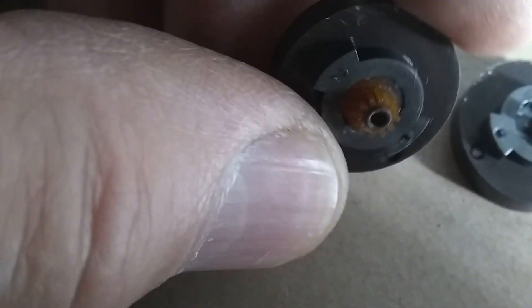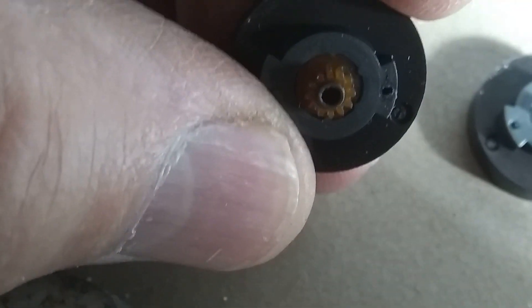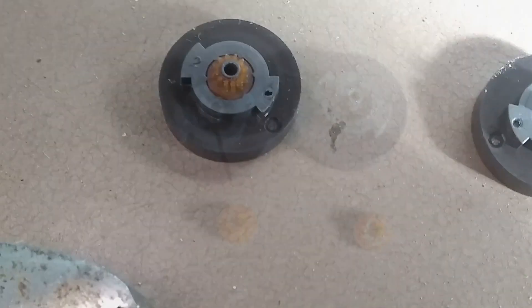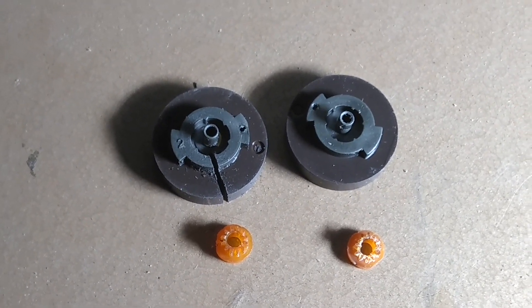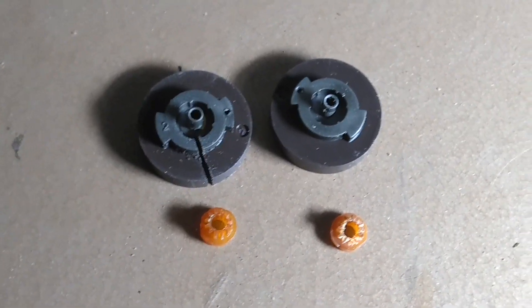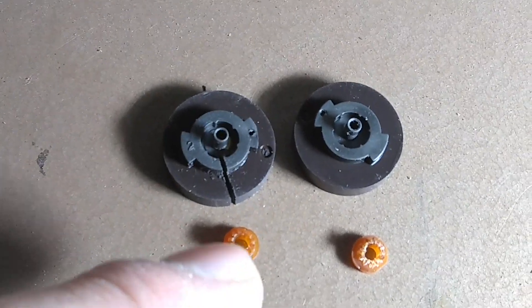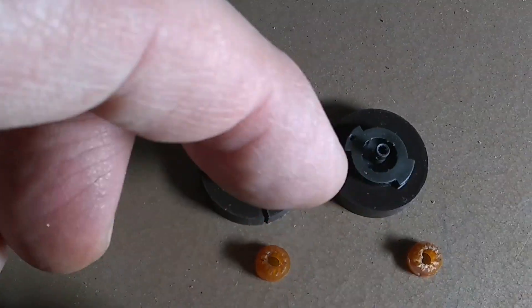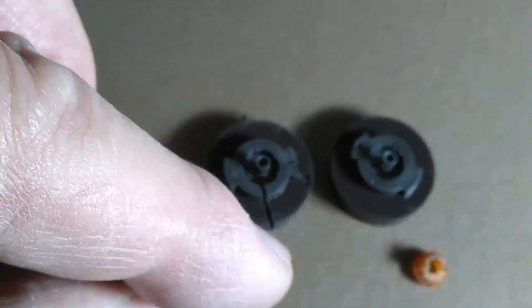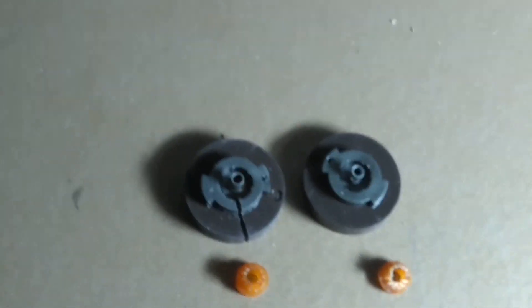I can do it by very carefully destroying this gear and removing only the yellowish plastic tooth gear. I managed to cut the good gear with a hacksaw, then split that part and removed the gear. The old one is broken, so I'm going to insert this gear from the donor timer into the old rotor.